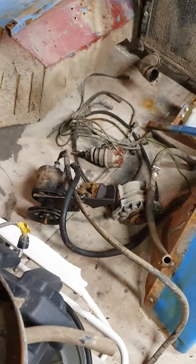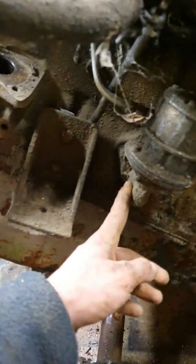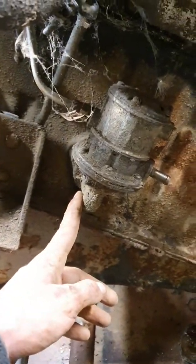I'm actually pretty happy with how easy it was - I've only been at this for about an hour and a half. I've got most lines off, drained the fuel tank, pulled the starter off, pulled the power steering pump off, got the dizzy out, and I just have to take the intake manifold off and the fuel pump off. These are crank-driven fuel pumps and I'll convert that over to the other motor.